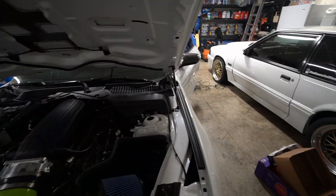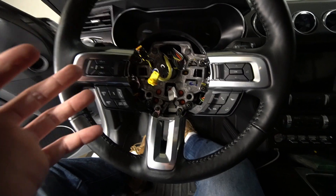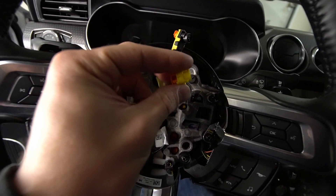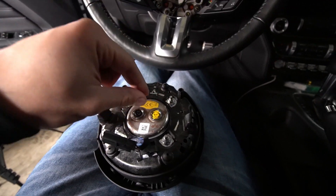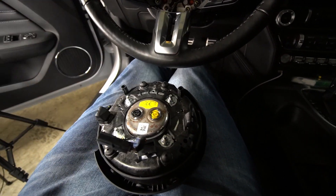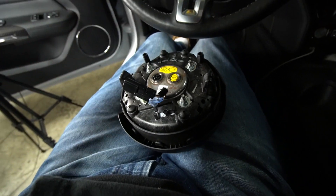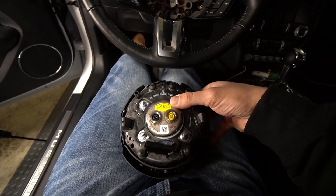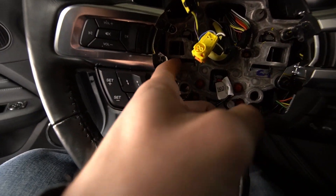Now we're back in the car and I can give you guys a better look on how to get this done. Don't be alarmed by all the wires — it's a lot more simple than you think. These two clips right here are for the airbag, they just push in and clip. As you can see how that one comes out — it's not a flip or anything. You'll see them connected to the airbag; they pop right in, one and one, and you just pull them out on each side. This piece right here has a little clip in the back — just push it ever so slightly. You're going to need two hands to get that done.